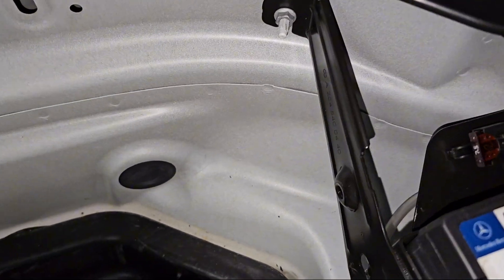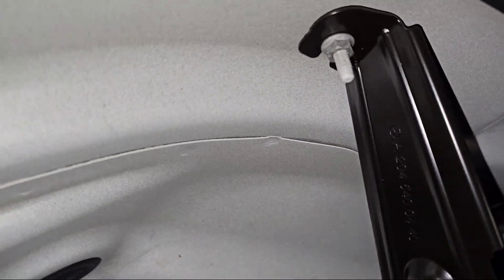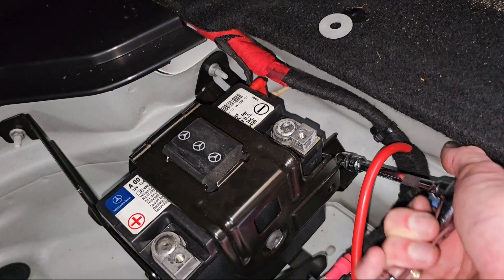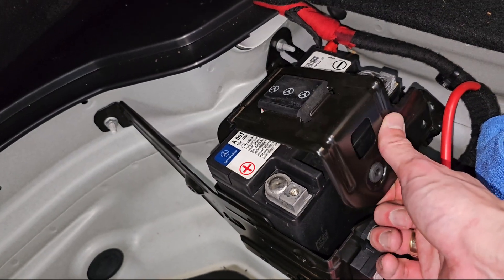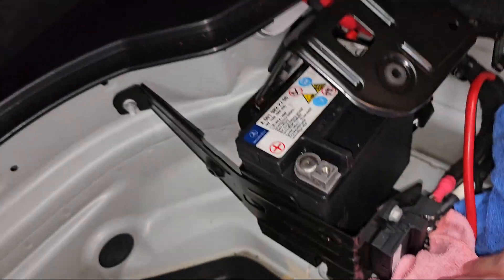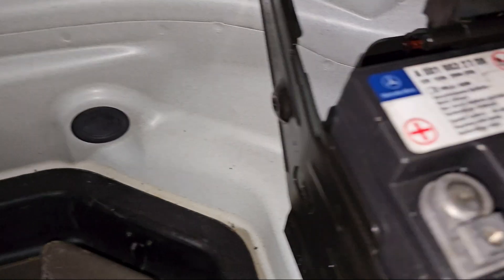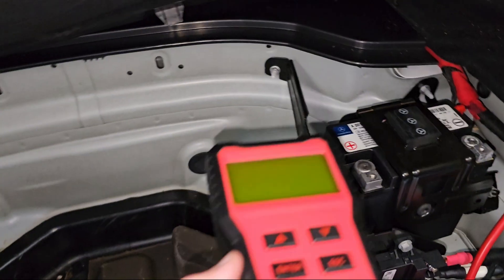The question is how powerful this one is — I'm pretty sure it should be either 170 or 200 amperes. I'll take off this protective cover to double-check using a 10mm socket, and then I can open it. The terminals are still secure, that's all right. This one is 200 amperes.